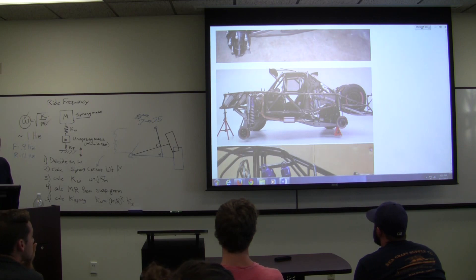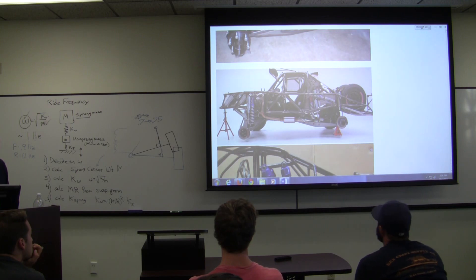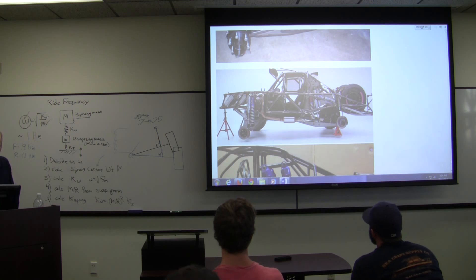This one does it nicely — the spring is being fed right into that point, so that's very strong from the frame. And the front spring is fed right into that point. But the motion ratio is not very good; it's still about 0.5. Still all triangles — triangle, triangle, triangle — so they know what they're doing for frame design.